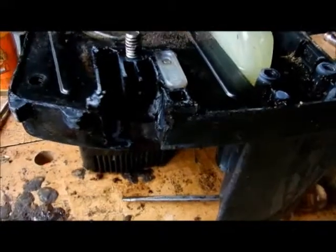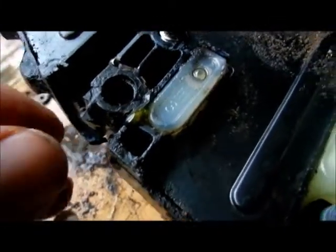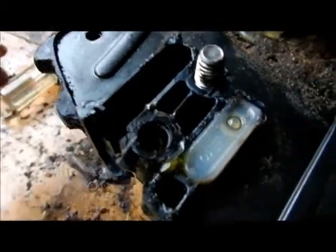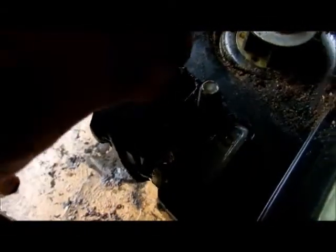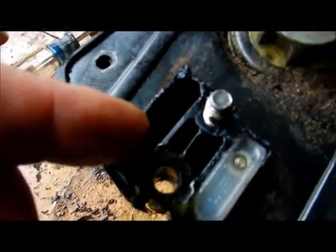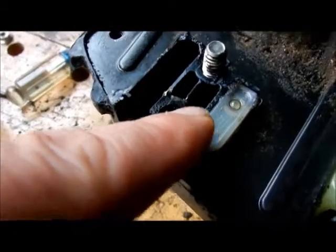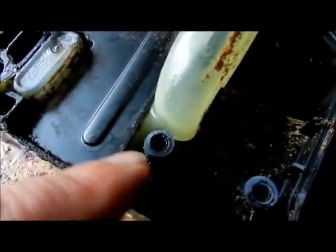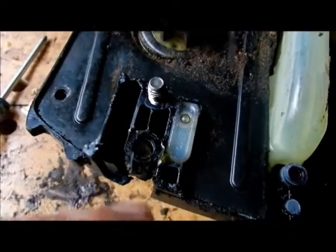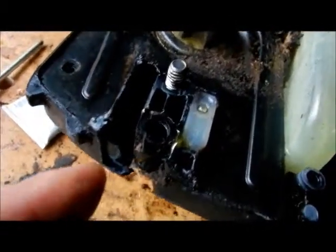The big job is going to be this piece here to build it up. I already have the other half inside close to the wood burning stove so it cures overnight. I put some gorilla glue around this and set it in there. Here's one really important part — this little piece that runs across this track. You need to make sure that area is clear, so you might have to take a razor blade or knife and trim that away after this dries. We're going to let this cure overnight — even though it takes only about an hour or two, I'm not in a big hurry.